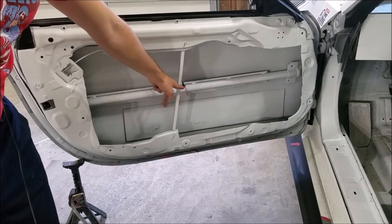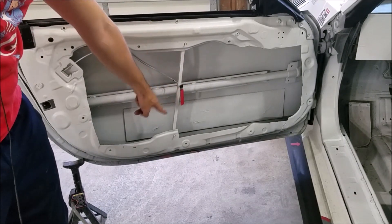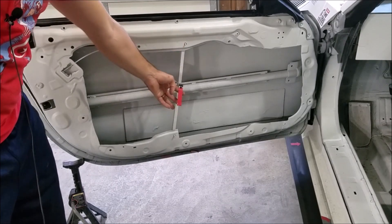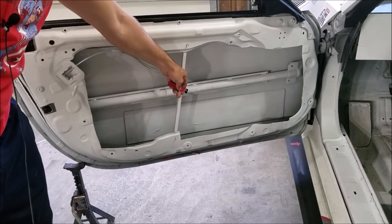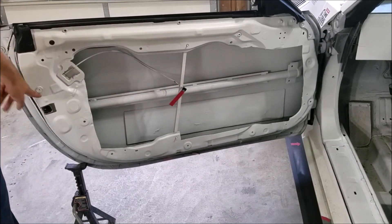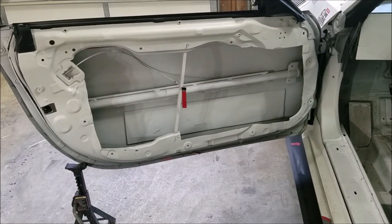This is just a piece of aluminum angle that I cut a little notch on and snapped the factory wire into, then bolted down on two factory holes that already had threads in them. I attached a little red strip to the end of the wire, so when I pull it forward it'll actuate the door like it normally would with the handle. Some people retain the handle, which is perfectly fine, but this was easier for me to reach from my race seat with the harness tied down. It also looks a bit more like a Porsche RS with just the little pulls instead of a full door mechanism.